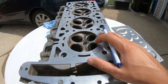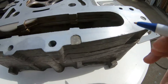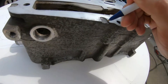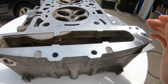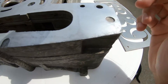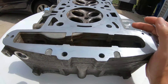There are also these little pins here and here — you can check if there was any previous machine work on the head based on how much height these pins have. We still have a step edge on all of them, which means we can still machine this head if we needed to. If the surface becomes even with these holes, you can no longer machine the head and will need a replacement.